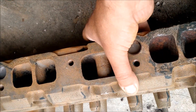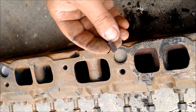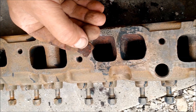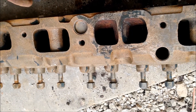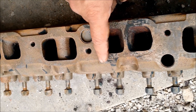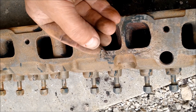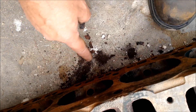It continues eating on the thick rust. So on this particular head, it had thick rust, especially in some of the exhaust ports, like right here and here. And this rust actually came off after I took it out of the molasses. What I do is I take it out of the molasses and I power wash it. Most of it dissolves and blows away, but this was real thick — I actually just chipped it off and it came off real easy. You can see some pieces that came off right here.